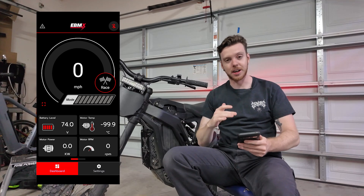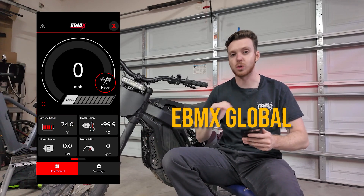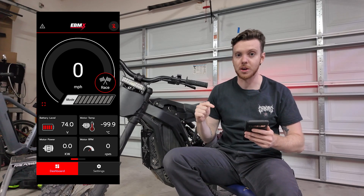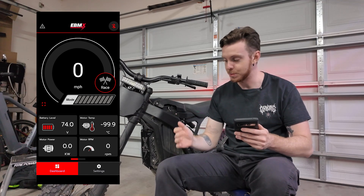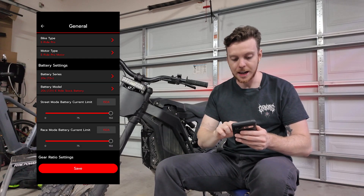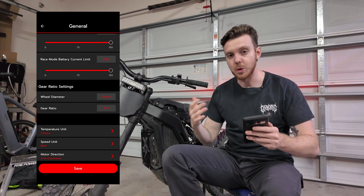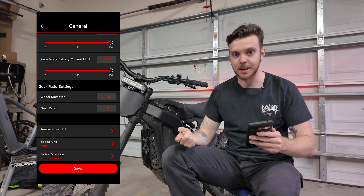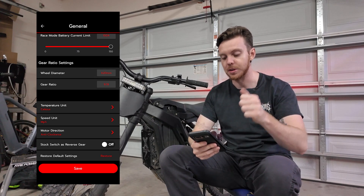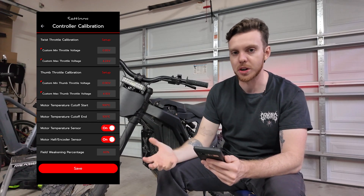Before we end off, I just want to jump in the app real quick and show you guys around. I'm not going to do a full explanation on all the settings — I'm going to leave that to eBMX Global. That's the main YouTube channel for this company and they do a great job walking you through how to install it, how to set it up for each individual bike, going through every single detail of the app. First thing you want to do is get a moto stand to put this on because you're going to want to do a calibration setup. Jump into settings, head over to general — this is where you want to start. Make sure you select what bike, type of motor you have, battery series, all that stuff, then hit save and it'll do a calibration. Also, if you put new wheels, tires, and gears on, put that into the app as well and rerun the calibration so it compensates for the new upgrades. Also make sure your motor direction is set to anti-clockwise unless you want 17 kilowatts of power going backwards. You'll also want to do a controller calibration — that'll just require you twisting the throttle a couple times so the controller knows what it's doing.